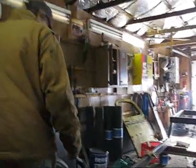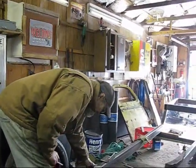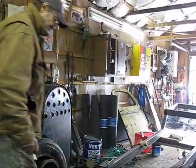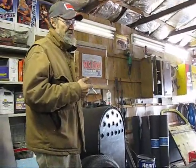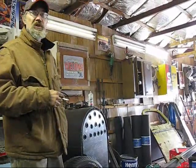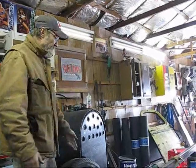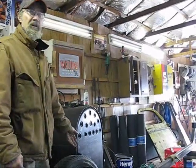It took me a while to figure it all out, but I think it's going to be a pretty good ride. Yeah, I think it's going to be awesome. Just use the drums. It shouldn't cost that much for wheel cylinders. No. And a set of pads and some springs. Yeah, that's right. And the bearings look fine, so I'll just clean them up and repack them.